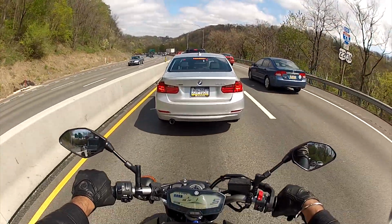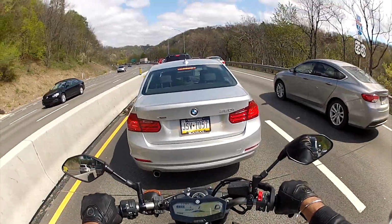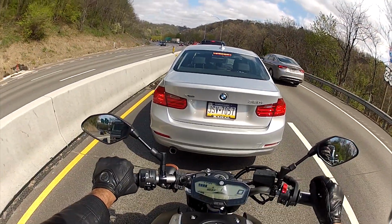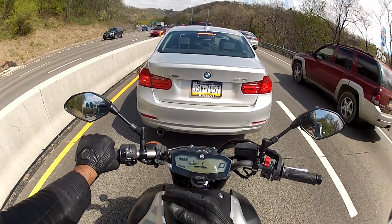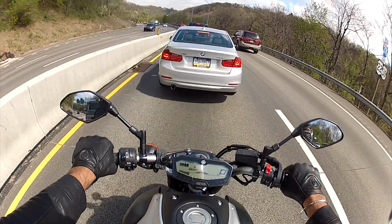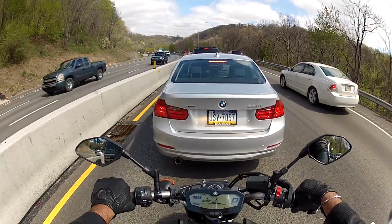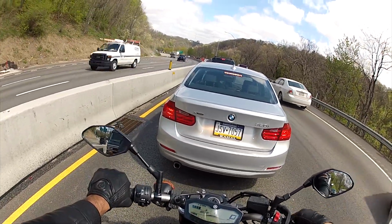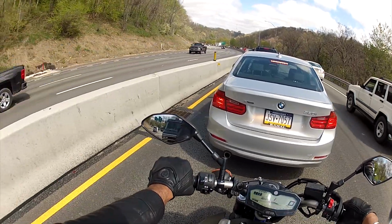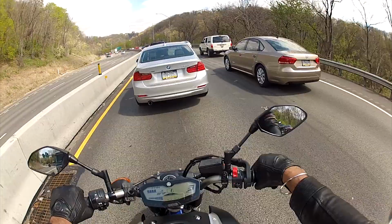We'll do a video on it when I do get it, because you have to cut the exhaust. The stock exhaust right now is all one piece. So you have to cut it right after the welding point and stick the M4 on and tighten it down. But because it's slip-on, of course you can get the full exhaust, and they're pretty expensive. It's like $800 to $1,000 depending on which one you want.